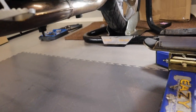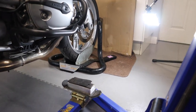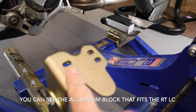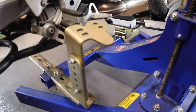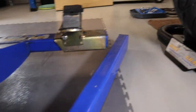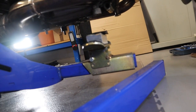What I should have mentioned is that on a GS you have to take off the sump guard because that gets in the way — just four bolts to take it out. Now I've got to position this in roughly the correct position. This here goes under the foot peg, so I line that up — I may have to drop it a little bit. And the front bar goes under the engine block itself, so I've just got to adjust things to get that to fit.